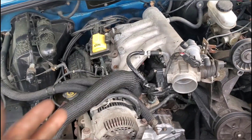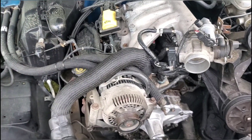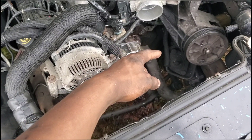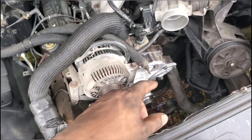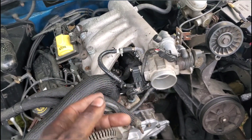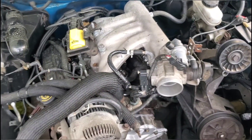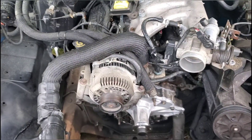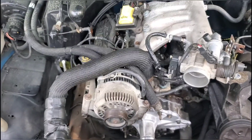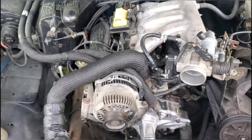The black one I had before from the 2007 Taurus did very well torque-wise — the neck actually extended to about here and it went straight from that to the intake. So this setup is a lot more peaky. I'm probably going to take it off and port the runners even more, and port that a little bit more — I want that to be almost wide open like a Honda. I'm aiming for peak redline around 6,000 RPM with this engine because the grenade point is about 6,500.